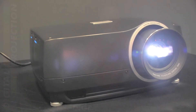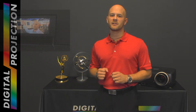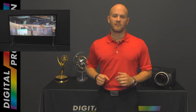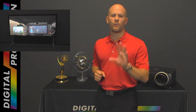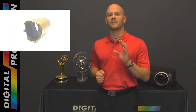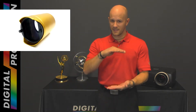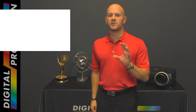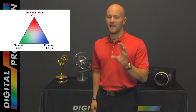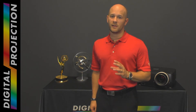In addition to the unprecedented pixel density, the D-Vision Scope 1080p presents a superior solution for moving between 1.78:1 and 2.35:1 aspect ratio content, or content wider than 1.78:1 — that's 16x9. Traditionally, an anamorphic lens has been required in order to move between different aspect ratios while displaying constant height images. While this approach produces solid results, anamorphic lens solutions can add significant cost as well as mechanical and optical complexity to a home theater system.